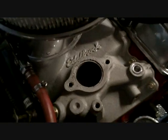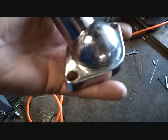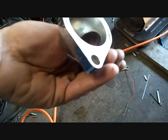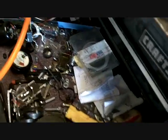But I'm going to blow that dry and put some silicone around it, put the new gasket on, and put the cap back on. Now, if I could have, I would have gotten one of these in steel, and I would have gotten an original, but finding an upright one that points back, even Dawn didn't have one. And it looks like there's supposed to be a rubber seal that goes here, too. What's up with that? I don't remember an O-ring. Of course, something else to play with. I have O-rings. I can probably get one to fit.